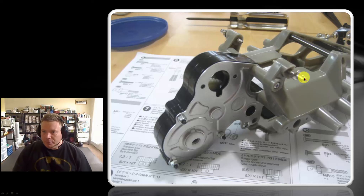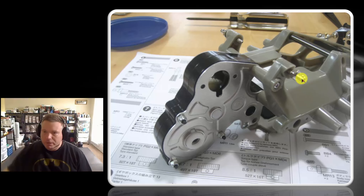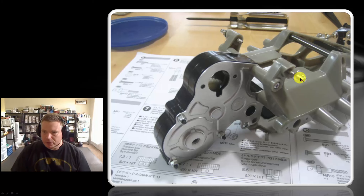This is what it looks like when it's all mounted up. You put the motor mounts or body mounts through — I screwed them all the way until the flush part was only visible, with no threads visible on this side, and my body hole pins were vertical so that the body pins would go in vertically. Also, a fair amount of threads protrude past the body, which I confirmed looking at pictures — so it's assembled correctly. They are adjustable so you can screw them in and out to give the right amount of width.